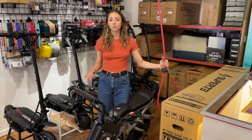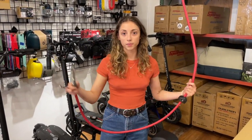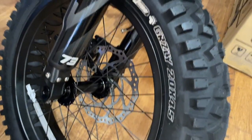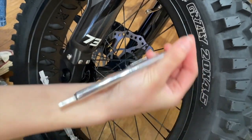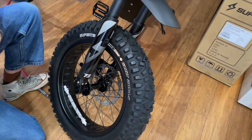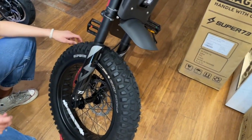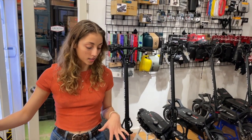Now another sip. You're going to want to check the tires — make sure they're at the correct PSI. You're going to need a tire gauge and an air pump. Come down here, take the cap off. They're obviously pretty low — you want to set these at 36 PSI. Then just repeat on the back.